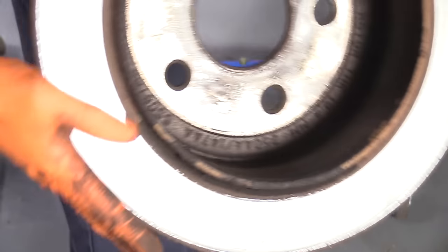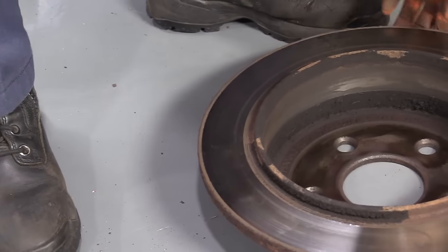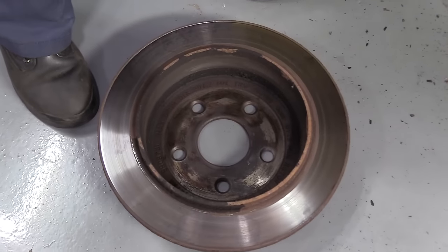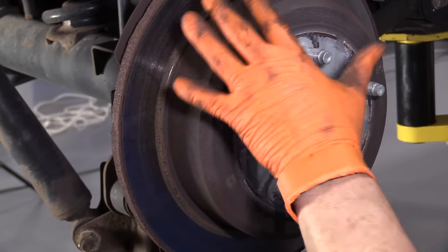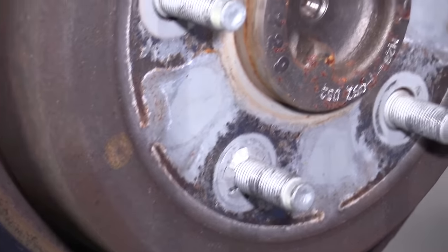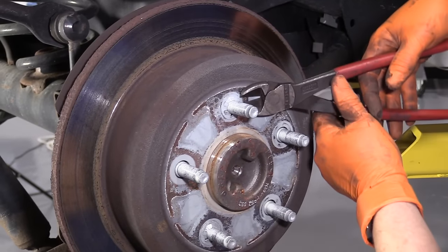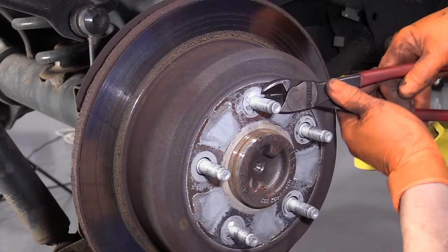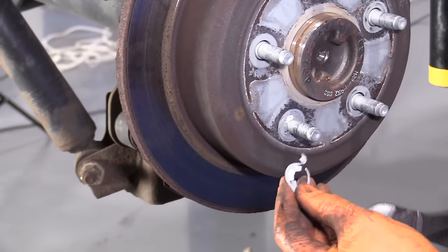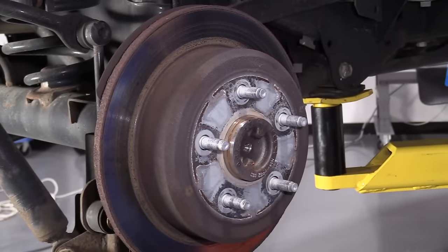I lucked out. You can see this rotor has got a big lip on it, and the inside is where the e-brake rides. Looks like we had a fluid leak at one point — looks like the axle seal was leaking. Whenever you get a new vehicle — this is a 2015 — these clips right here are an indication that someone has never taken this rotor off. That comes from the factory assembly line. They're non-reusable. To remove them, I just take a pair of nippers or cutters, slide it in that ear, pull it up, grab it, pull it out, twist it, and it'll break right off. You don't need these — they're on there to hold the rotor flush as it goes down the assembly line.